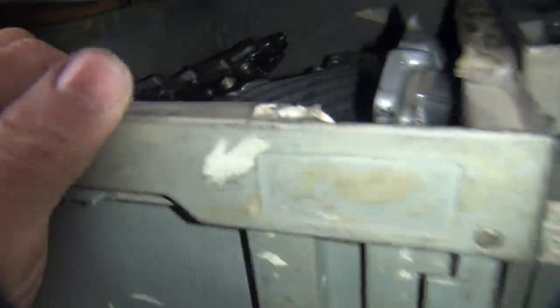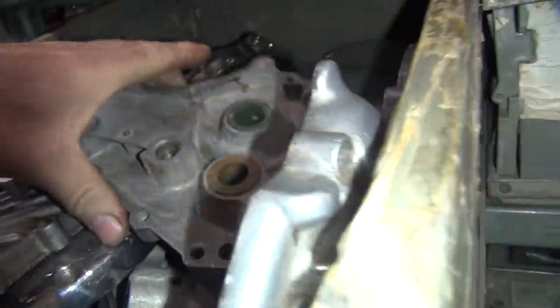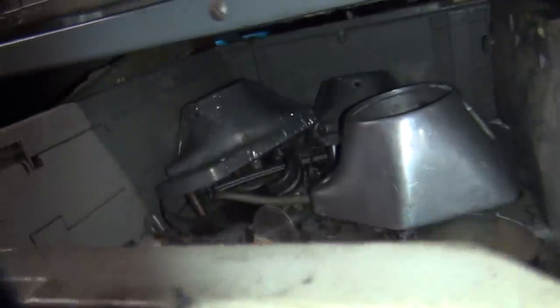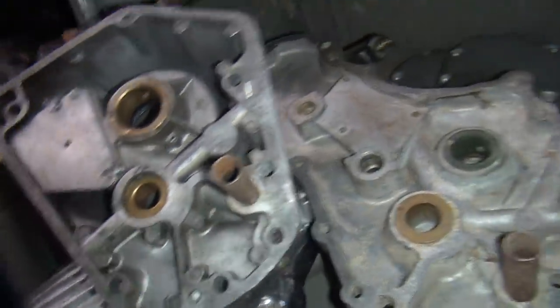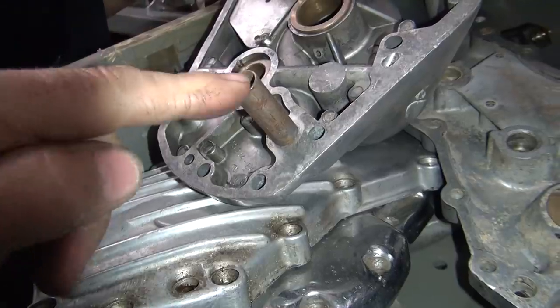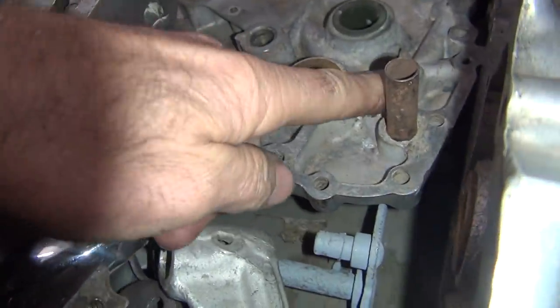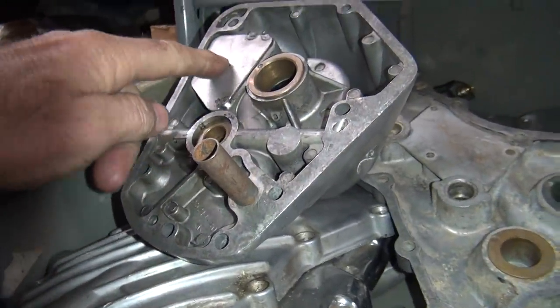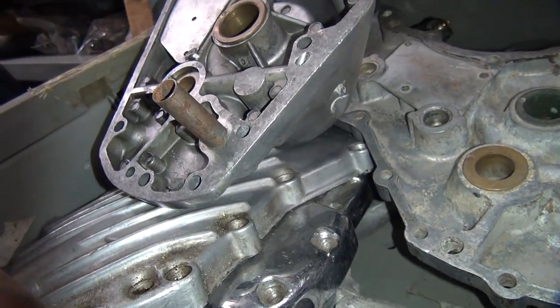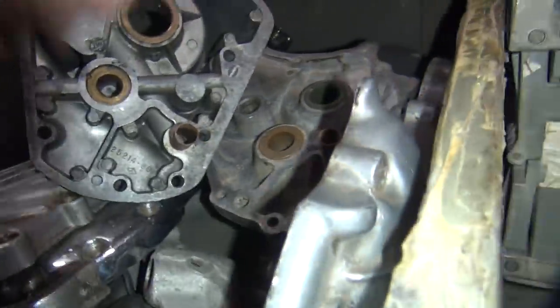Now we move over to a breather. Here's a cam cover - it's a generator cam cover, but it's the same system with the generator cone motor and Evo. Here's an Evo cover - they look the same, they're identical, not quite but close. This is called a breather chamber. This has a breather tube, and this one here has a breather chamber and a breather tube. See this cavity right here - that's where the oil is, that's called a breather cavity. That is supposed to be dry - that's why there's a gasket that goes around it. When you've got a bunch of oil in your motor, it overflows and fills up, goes up into the breather, then goes down the tube and fills up the whole orifice full of oil. When you put air to it, it pumps it out and blows it out of the motor.